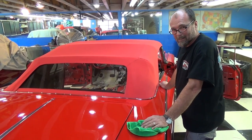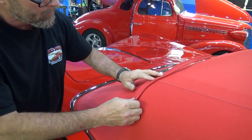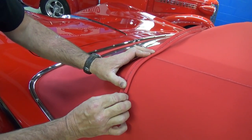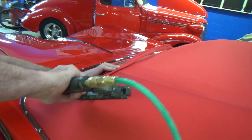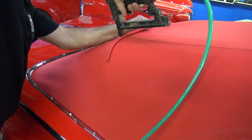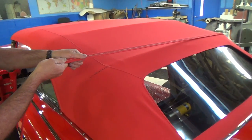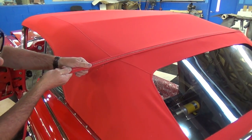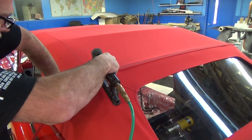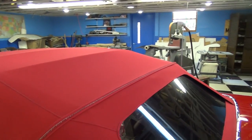What we're doing right here is putting the wire-on on — this hides the seam, it goes all the way across, and then you put the little chrome ends on it. I'm coming down to where it looks good, then I'll measure the other side and cut it off the exact same length so both sides are exactly the same. I've got the staple good on that side, now I'm going to pull a good straight line all the way across and set it right over my staples. Then I'm just going to run a row of staples right down it.